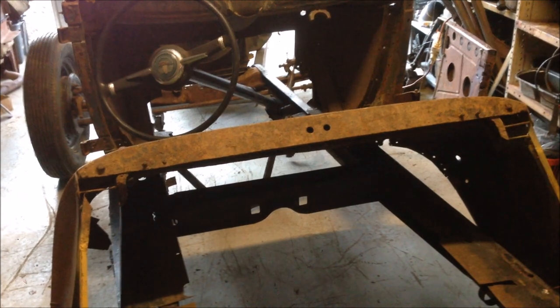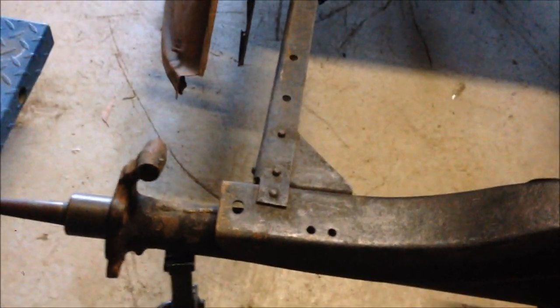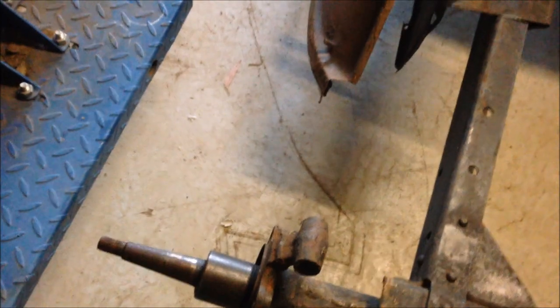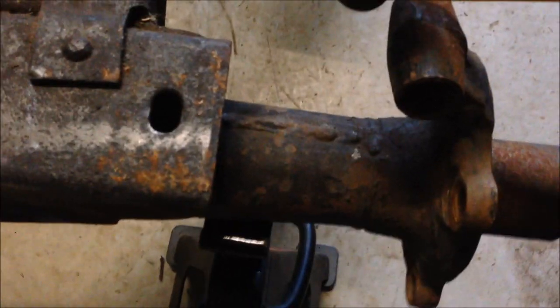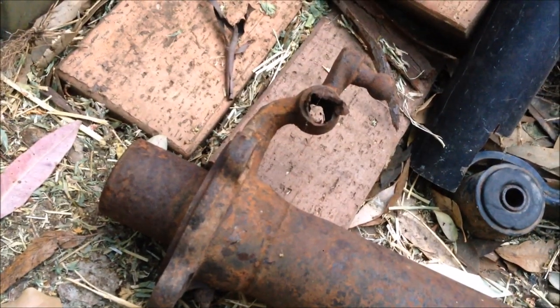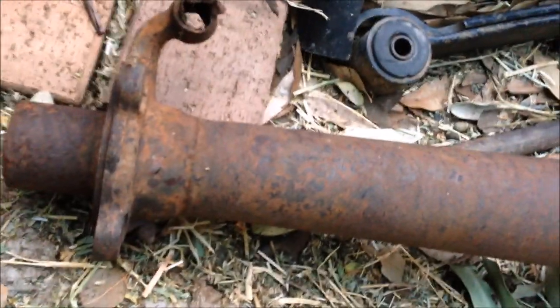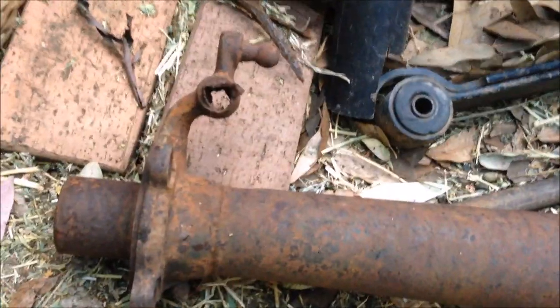I've got to rebuild that front end, basically from scratch. The '32 axle with the diff — this is a good working diff — but when you put hydraulic brakes on these things you've got to cut off the ball that's on there for the rear shock. I've got old diff axle tubes here and you can see they've got the ball on there. I'll clean these up and fit them to the diff center so we can fit original shocks. We're not restoring it, but I want to make it period correct, so we've got to do it right.